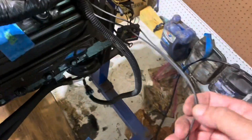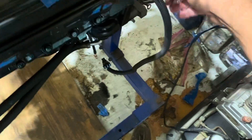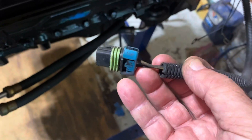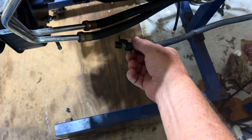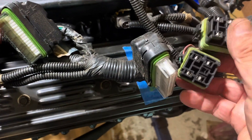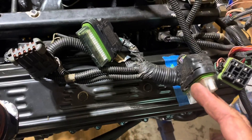There are two wires with large ring terminals — those are grounds. They're going to land on a ground bolt for the bell housing or flywheel cover back there. Then this left-over connector is the fuel pump connector — this is what runs your electric fuel pump. The fuel pump mounts right down there, this connector goes down and runs the fuel pump. It's controlled by the computer — it's turned on and off by the ECU. I had to buy brand new relays because the other ones got stepped on and broken.